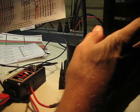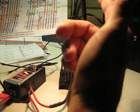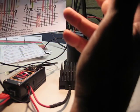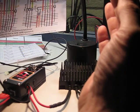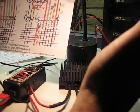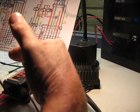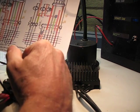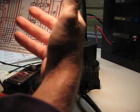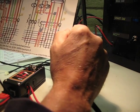That is really all. If you've got a standard fuse box with a main fuse from the battery, the ignition circuit, or the signal, ignition, and headlamp, and an accessory, then your harness is already basically set up to accommodate the solid-state power box. The only thing we had to do for the ignition circuit was these three modifications, and they're all right in your headlamp.